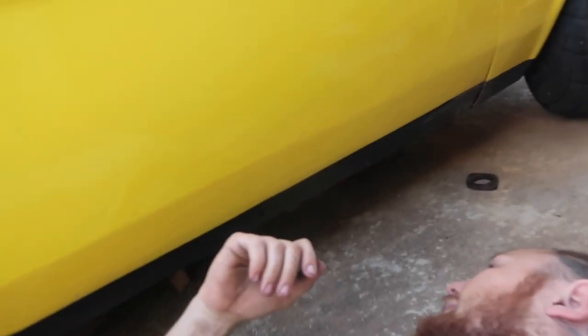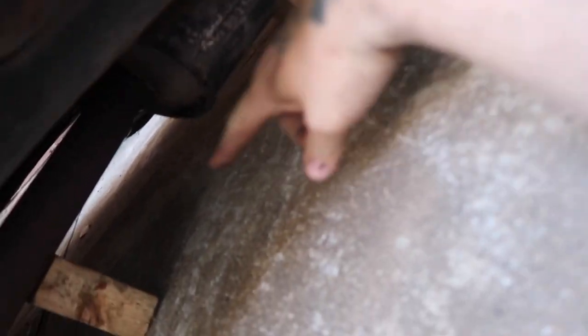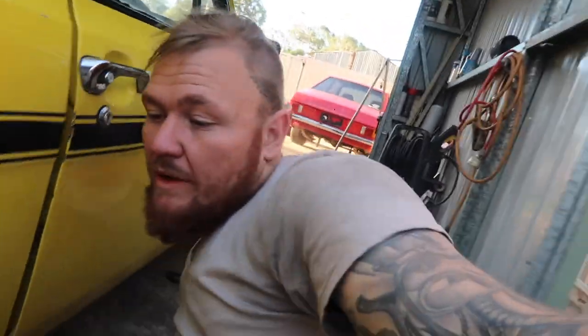I've cut the old exhaust off and got the new one kind of in place — just propped it up. It's probably the wrong way to do it, but if you're in a rush for an exhaust, well, this is my way. I've propped it up with some timbers so it matches the flange, then lined up where it needs to come out — needs to be 300mm behind the rear window, facing down at 15 degrees or something. I don't know why I'm worrying because these things run on semi-slicks and a lot of other stuff that would make it defectible. It's just for the weekend. I'm going to run my chalk down the existing flange to get the exact same angle, take a sliver, put it back up, take another sliver — keep doing that till it measures up nice. Then we can weld the flange on. Looks like we've got that job done quicker than I thought. It's dodgy but it's only for the weekend.